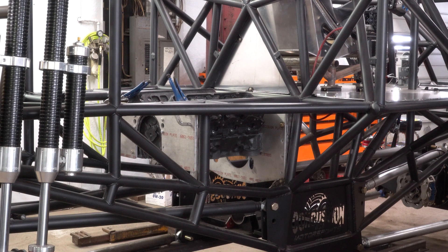Right there I got the motor mounted in, and that's not the real motor — it's called a mock-up block, made out of foam polyurethane, real lightweight. That makes it a lot easier to work with than an iron block. There's a plate in the front and a plate in the back, but to get that thing square in the chassis takes a bit of time. I do this stuff by myself, so I got it perfectly square — that's really important because if something's off even a sixteenth of an inch, by the time it gets to the tail shaft and the transmission it could be quite a bit off, and your transfer case won't line up.